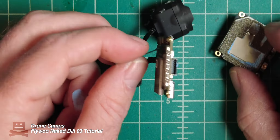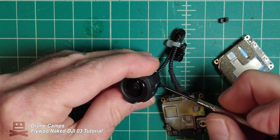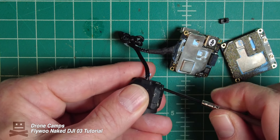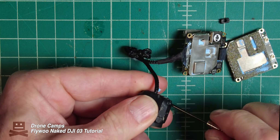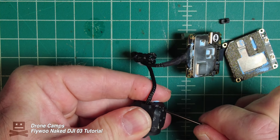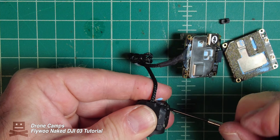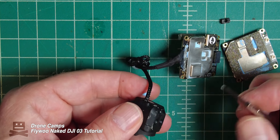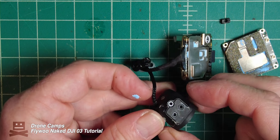There is a little grommet on the back where your cable comes out of the camera. Take a nice thin razor blade, stick it in there, and pull this grommet out slightly, then use your fingernail to get it the rest of the way out. Next, grab your screwdriver and remove this side bolt, then get the other side too. Try not to force these bolts too much because you might strip them — make sure your screwdriver is nice and flat and apply a little bit of pressure.